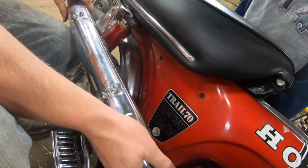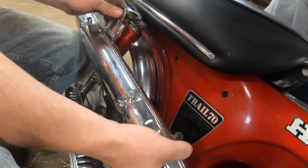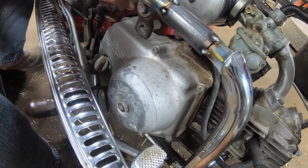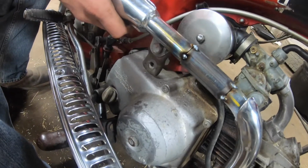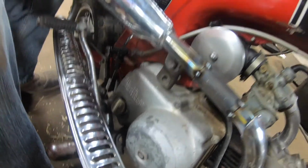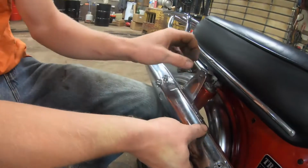Yeah, but she's way off. That one's off and this one's off. We need to put more pipe in there. How much gap do you want to fill? We can either fill the gap or just cut a new piece of pipe, one of the two. How much longer do we need to be? By the looks of it, half an inch? About 3/8 of an inch, or 5/16. Or one full 5/16 bolt off.